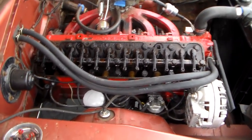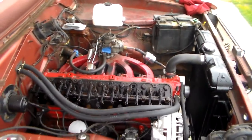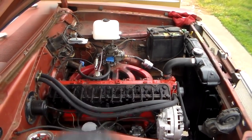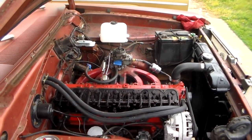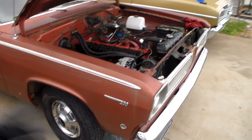These sound pretty good. You want to make sure that you do not tighten the exhaust valves too tight because that will hang them open. And not only will the engine run rough, especially at idle, but it will burn the valve because the valve has to seat on the valve seat in the head to transfer the heat away from the exhaust valve — otherwise it'll overheat.